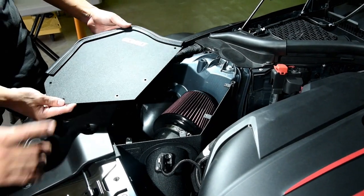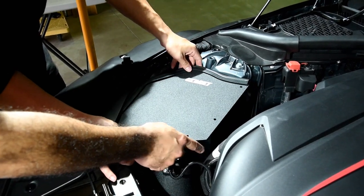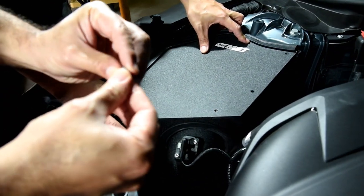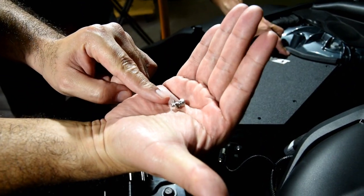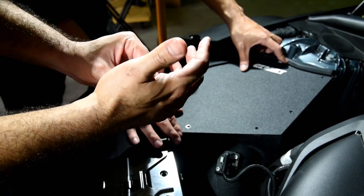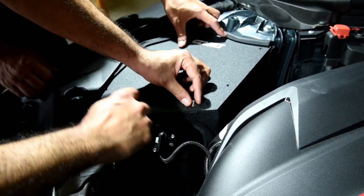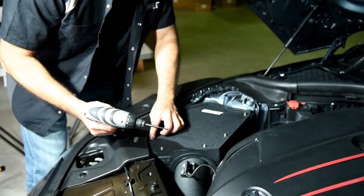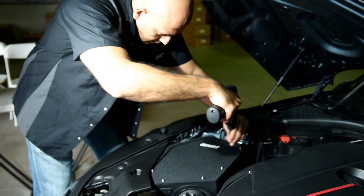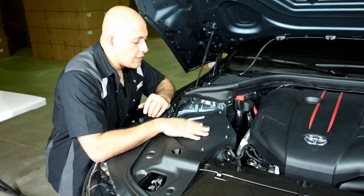And for the final step, we're going to place the heat shield on. Okay, so we will align the holes. Now for the purpose of this demonstration, we're going to just tighten it up. We have the washer here and the bolt here. And then we again make sure that it's properly aligned. So you've got 5 holes. So 1, 2, 3, 4, and we're just gonna go ahead and lock them all down. And that completes the installation today, guys.